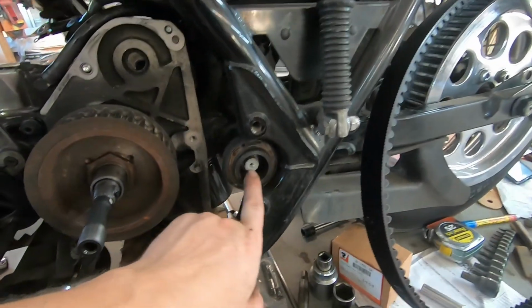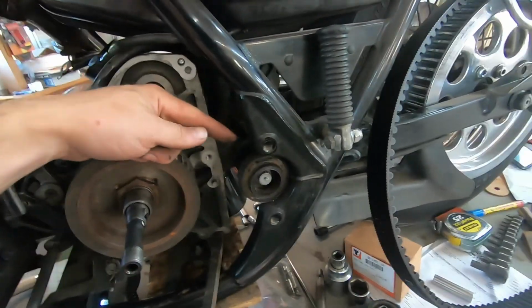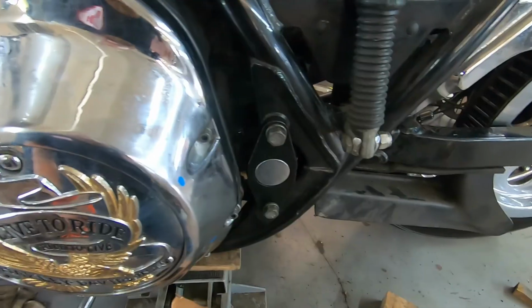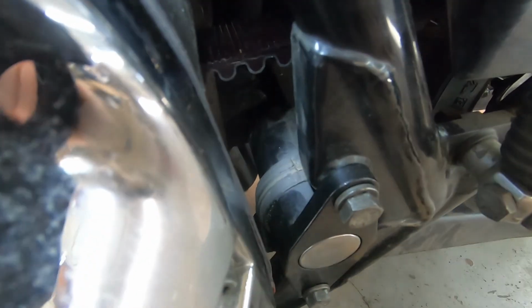unfortunately, the bolt that holds in this swing arm is incredibly hard to get out. After these Harleys get a bit of age on them, those bushings become incredibly dry, and a lot of times the bolts seize on the shaft. If you put an impact on there, they won't even budge. If you put a long breaker bar in there, you're liable to break that bolt off in the swing arm. So you don't even really want to mess with that bushing unless you absolutely have to.